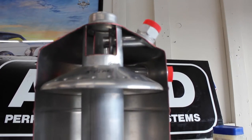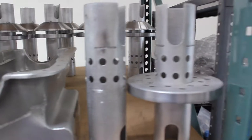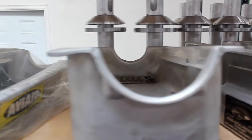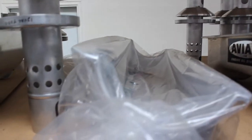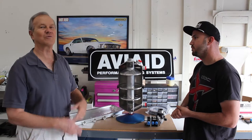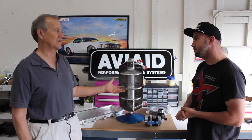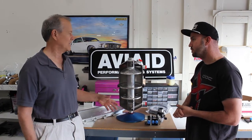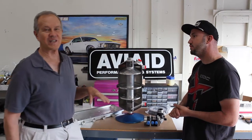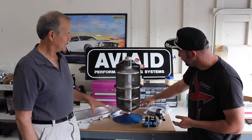And we do that in a couple of ways. It comes out of the return on the side of the tank, and it blows out into open space where it essentially falls onto the baffle, which is the initial release mechanism. Then on the baffle, it tends to flow down in a thin film, which is a secondary release mechanism. Then it drops down into the oil in the bottom of the tank, which is the reservoir. We typically want around a third of the tank's capacity in air gap above the oil in the tank. Okay, so you're only filling it to this height then?